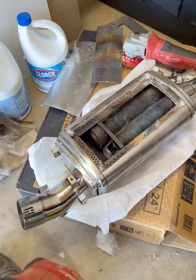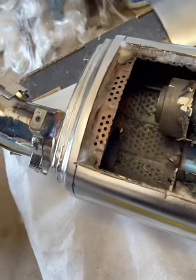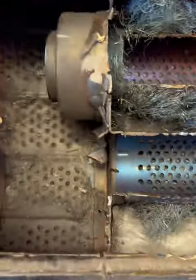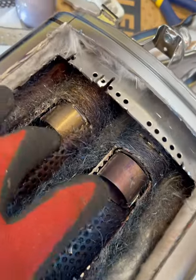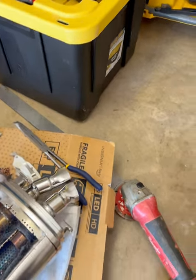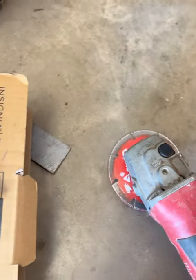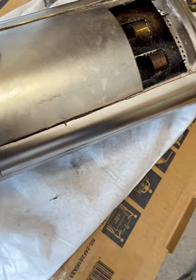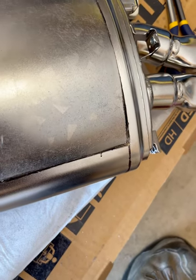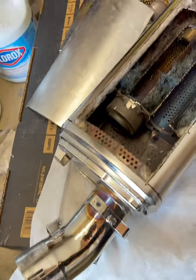We are at the point where I have a completely straight-through design — nothing obstructing my inlet, this one is straight through, this is obviously straight through, and both of these are straight through. All this is done with a Milwaukee 18-volt four-and-a-half inch side grinder with a diamond tip cut-off wheel. Pretty easy — just focus on making clean cuts so that when we weld this back together it's going to be as nice as possible. That back side is going to be exposed so I'm not sure exactly how it's going to look yet.